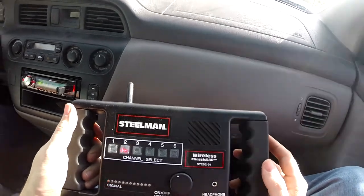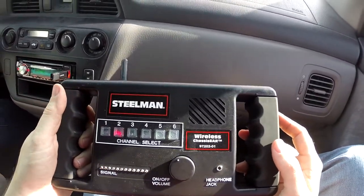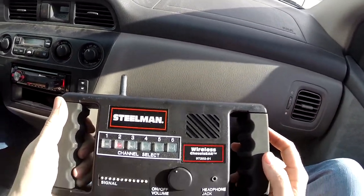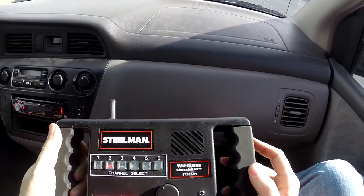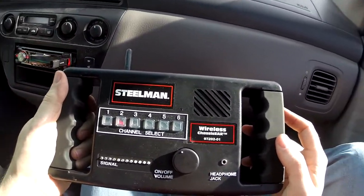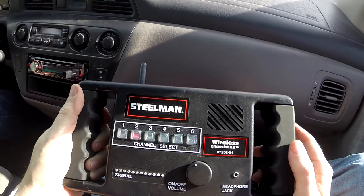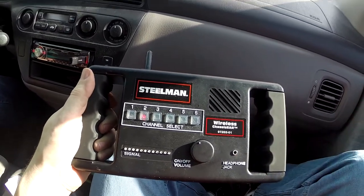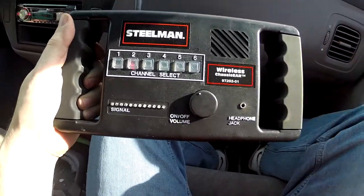It's something behind there. It's the ball joint, or it is something related to the front hub, because we're fixed hard to the front hub, or I should say the front knuckle. So that could be bearing, although I don't think it's bearing. Could be the strut, but like I said, the strut is new. The noise didn't change when the struts were replaced a while back. It stayed exactly the same, and it's actually been noisy like this for about the past year. But it's getting worse. So we're going to look at that ball joint real closely.